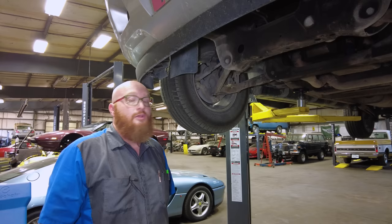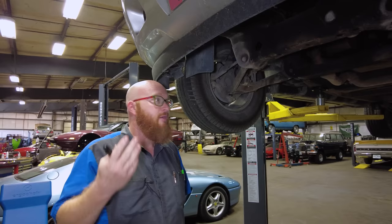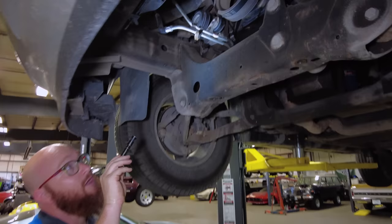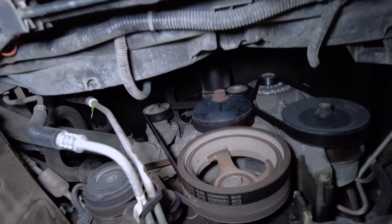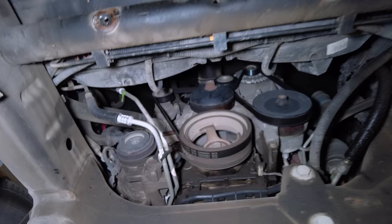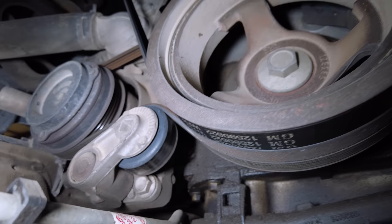We're not doing a full review — just some common items. You can also list more in the comments. Starting by the radiator, you can see it already has brand new transmission cooler lines, because they always fail — they start leaking where it crimps and drips red fluid all over the ground. I've seen this on Duramax, the 6.0, the 5.3, the V6 — it doesn't matter. They will all fail in the lifetime of the vehicle. There's also the small AC tensioner we mentioned — it's literally just two bolts plus removing the main belt.